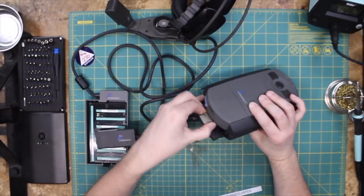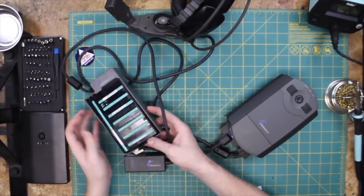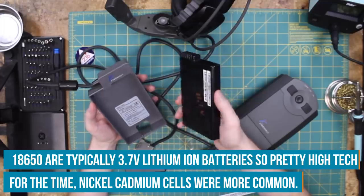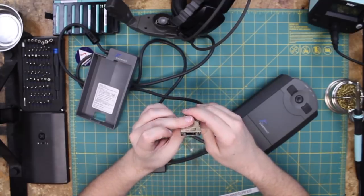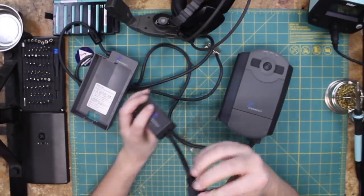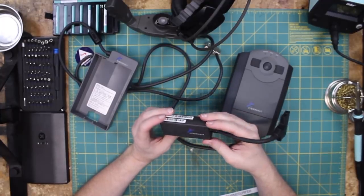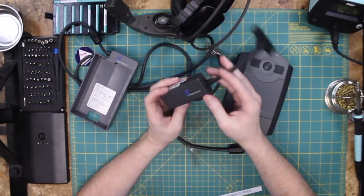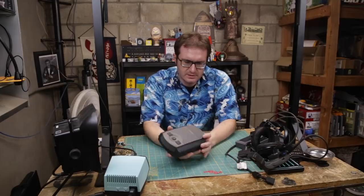First thing to do is unplug these connectors. So this is the power — here's the battery pack, a bank of 18650s, an ME202BB lithium-ion rechargeable battery with 11.1 volt output going into a DB9 connector with only five pins active. Here's this big proprietary port replicator piece — the Zyberport Mini. It has a standard PS2 plug for keyboard, mouse, and an FDD connector — presumably floppy disk drive given the era. Let's take a look at what we've got.